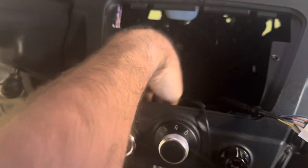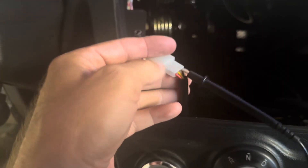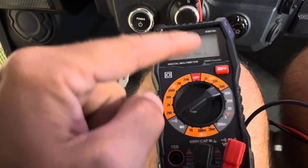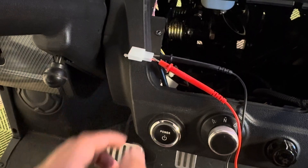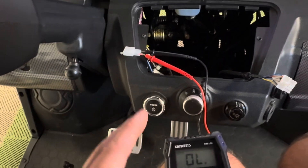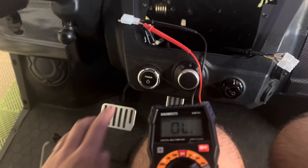To make sure our button does its job and passes on the voltage, go to the back of its lead and put your ground wire into the backside of the connector just up against the black wire. We're going to test whether the yellow wire passes on the voltage while we hit the button, so add your other probe into the yellow wire. With the multimeter in continuity mode — black probe in the black wire of the button and red probe in the yellow wire — when I hit the button, the multimeter should make a sound. That's a good sign: our button is passing on the voltage and it should be reaching the ignition box. If that's not happening for you, potentially your button got wet or is broken and is no longer working — that is likely the issue.